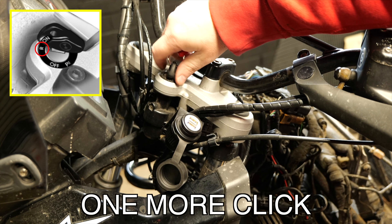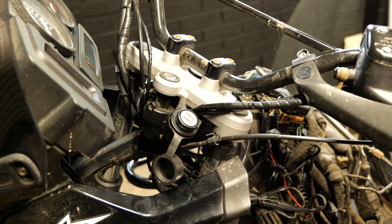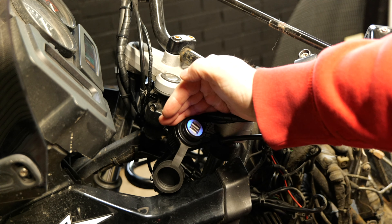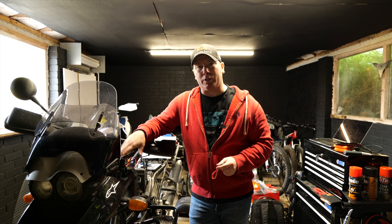With the key in, turned one way and removed — that's enough to loosen the handlebars — but as you can see, there's a light on on the USB chargers and that remains on for weeks at a time because that allows the bike to be moved around. As you can imagine, that's a little bit frustrating because that's what's been draining the battery.